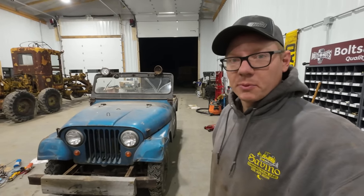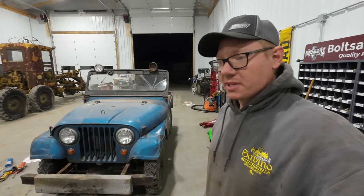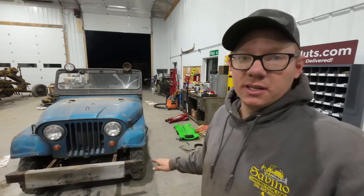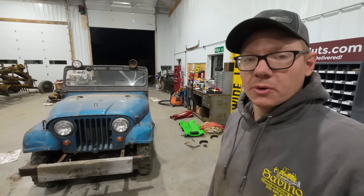So I guess in the next video, you're gonna be seeing this thing all the way around, because it's a pretty bumpy ride. The shocks, they're a little past their prime, so it definitely could use some shocks anyways. So we might as well get a complete suspension overhaul kit for all new leafs on it, all new shocks. And we'll know that this thing is truly safe for the road.